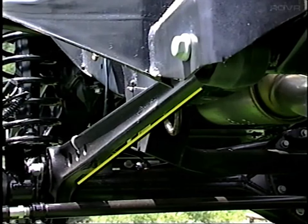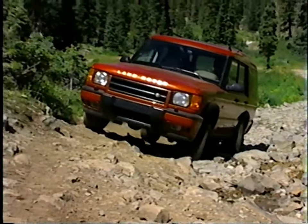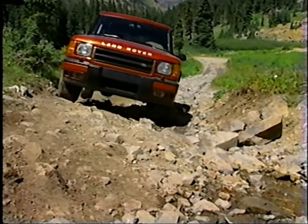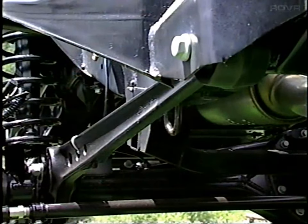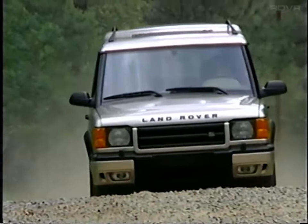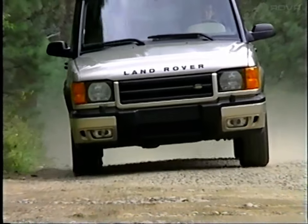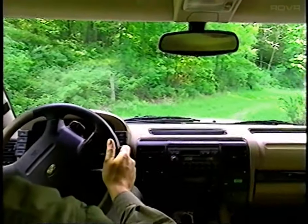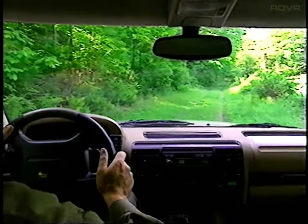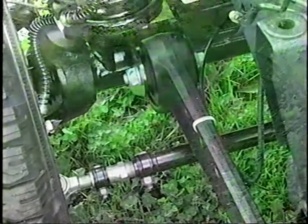On the front axle, radius arms on the Series 2 are longer than on Discovery. They provide longitudinal axle location and allow large articulation. The revised geometry of the radius arms, in size and mounting angles, also improves comfort by allowing easier vertical movement of the axle over road surfaces. Without proper radius arm location, the driver would, at one extreme, notice every bump in the road, or at the other extreme, be too isolated from the feel of the road.